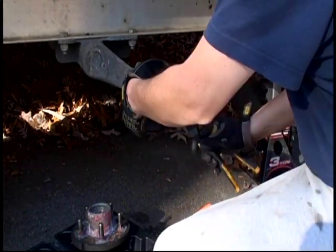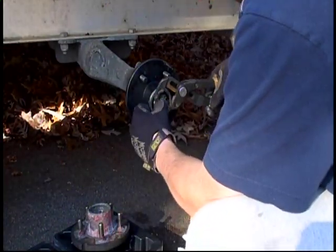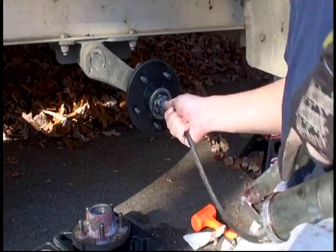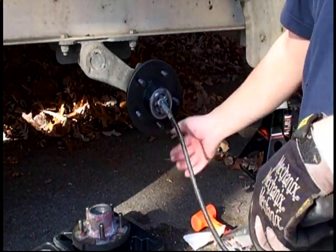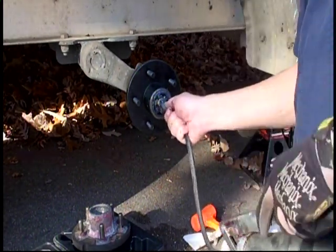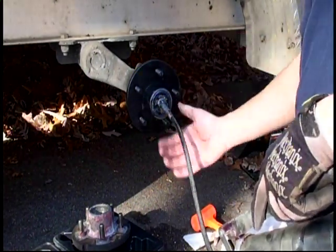Just snugged up. What we do is get it where it's snug and just back it up a little bit to where it lines up with the tab. Bend the tab out and we're good to go. You can see only a few pumps and that thing has completely filled that spindle. You want to fill the entire spindle if you can so you don't have any air in there. Any air can hold water, and believe me water will find a way to get in there. I'll go ahead and overfill them. You can't blow out any seals or anything, so I like to pack them really good.